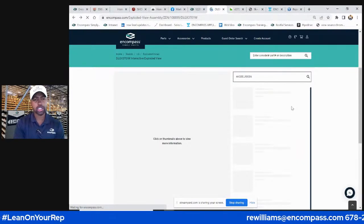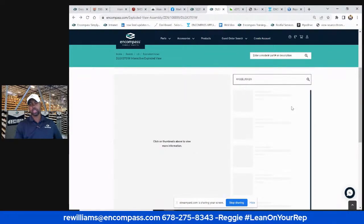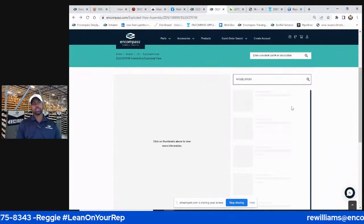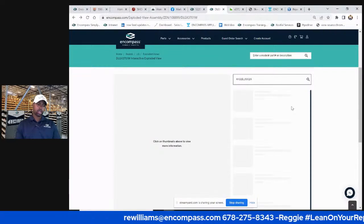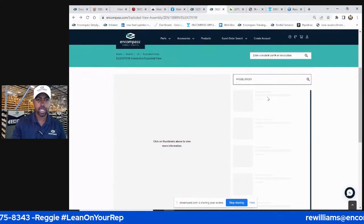But dryers, it's pretty simple, man. LG dryers, the only issue I ever had was the heating element. I mean, very rarely did I have issues with an LG dryer. If I did, it was because I needed a new heating element. And that was usually caused by neglect from the customer, either bad air ducts, or the dryer pushed too far against the wall, or squeezed into a small space, which looked like that picture.